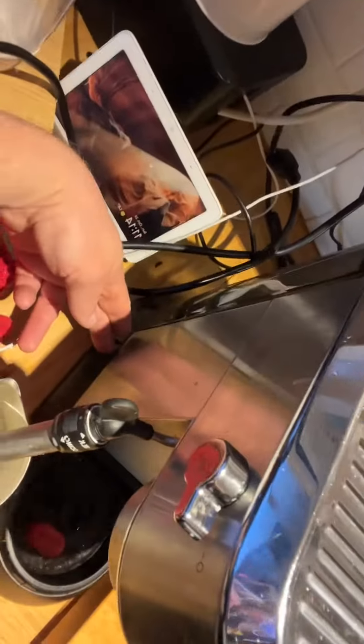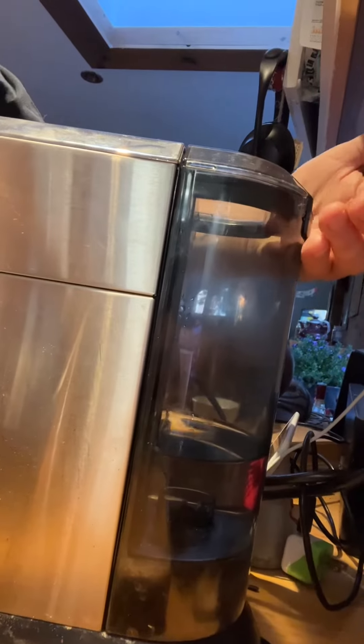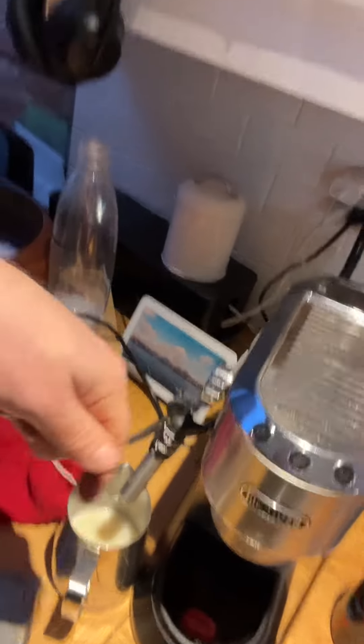Okay, so I'm going to just turn off the power now to shut this down. That's how you get the descaling rolling. The only thing you do at the beginning is take white vinegar and fill this — you can see this back here, this is the water channel. You want to fill this at least two thirds to three quarters of the way full of white vinegar, up to the max line, and then run that descaling process through — where you hold down this button and the whole thing starts shooting water — and let the vinegar run all the way through. Once that's totally finished, dump that back part out, fill it with fresh water and run it again, then fill it with fresh water again and run it again to make sure all the vinegar is out. Then your machine's good to go.